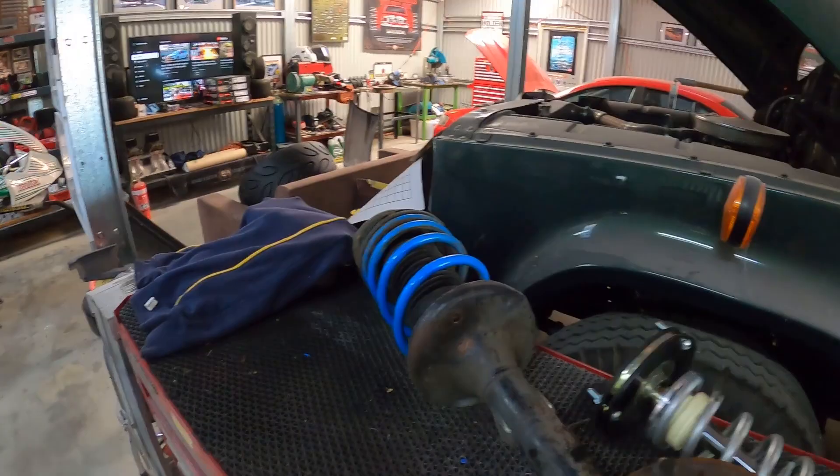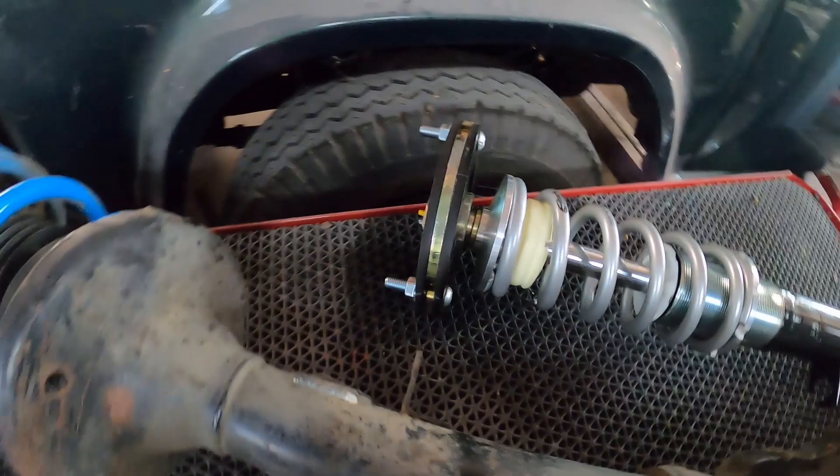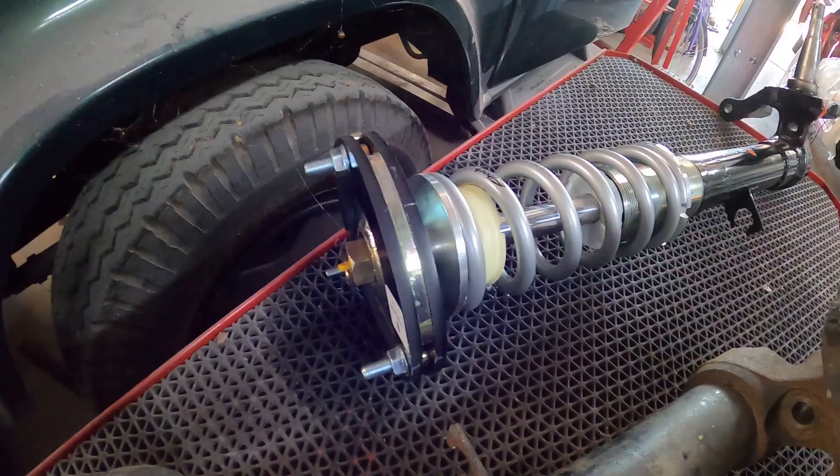They are very special indeed. The main thing is just having an adjustable camber top so we can dial in up to four degrees negative in the front, which is what we want — because we want this thing to go around corners very, very fast. That is going to be a big help.